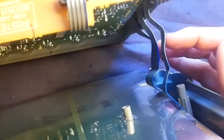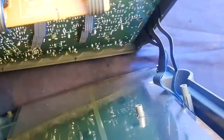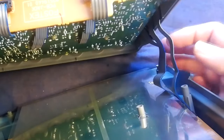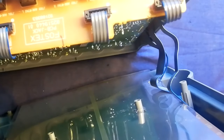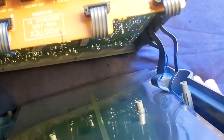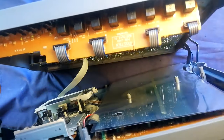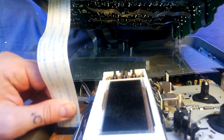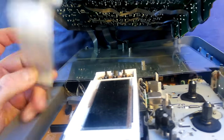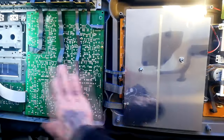The case will then come apart. The first thing you're going to see is that the two halves are connected by three ribbon cables on this side and a thinner white data cable on the left. I'm going to recommend that you don't detach these if you possibly can — I've had Yamaha and Tascam units where once they're out they're pretty difficult to put back in — so I'm going to try and hinge along this right-hand side and open it up like a book. As long as you pull this white data cable quite straight, it will just come out pretty easily, and then I can fold this open like that.